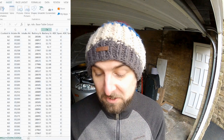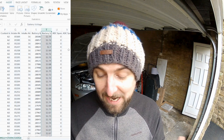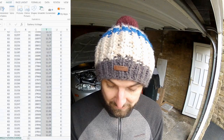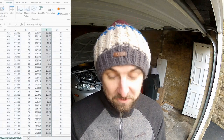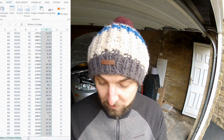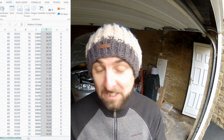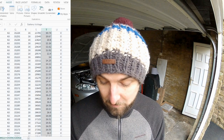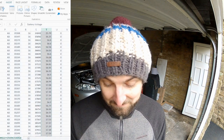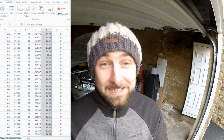I'm going to show you a log from one of the first startups. Pay close attention to the battery voltage column. At rest with the car not running, we're seeing 12.7 volts. Scrolling down, it drops to around 8 or 9 volts — that's me cranking. Once running, the alternator is charging so we see 14 volts. But scrolling further, we start to see 15, then 16, then 17 volts — and it tips over 18 volts as well, which is way too high for a car.